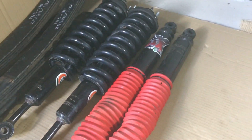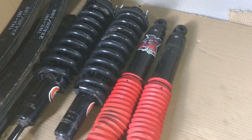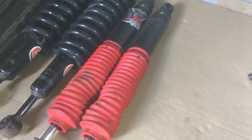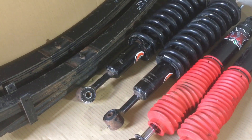Ideally they were meant to be fitted right. If you want to save some money, those strut tops on top are worth about $70 each, so there's $140 there - you can take those off and keep them. The struts, the coils, the shockers - you've basically got a kit. You need to get the bushes for the other end - that's the greasable shackling end, where you'd put your greasable pin.